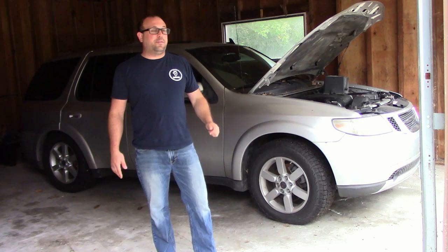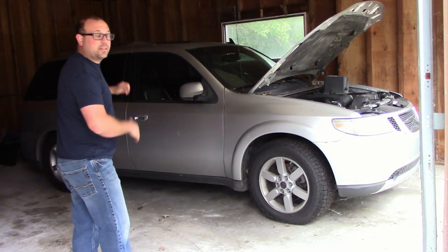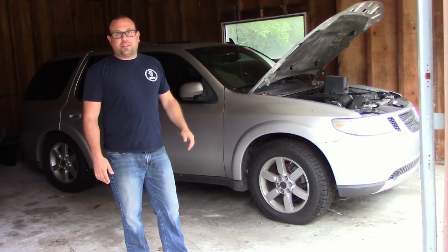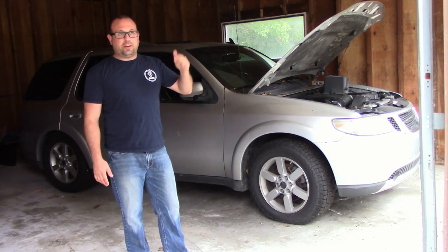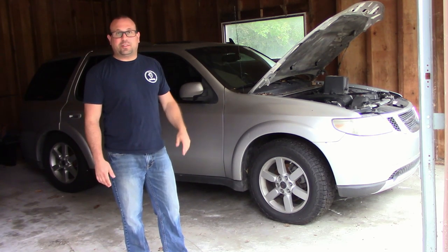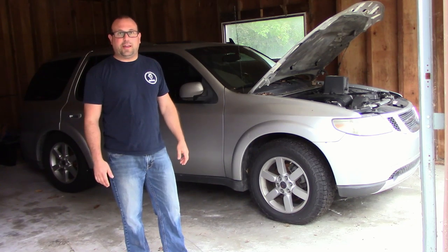Today we're over in my four-car storage garage with my 97X. It has had a DOD issue for the last 18 months. After the last video I made, which I'll put a link in the description below, I just took it and parked it in here so the lifter would stop machining the cam, because I'm pretty sure the stuck lifter is just grinding away at that cam.